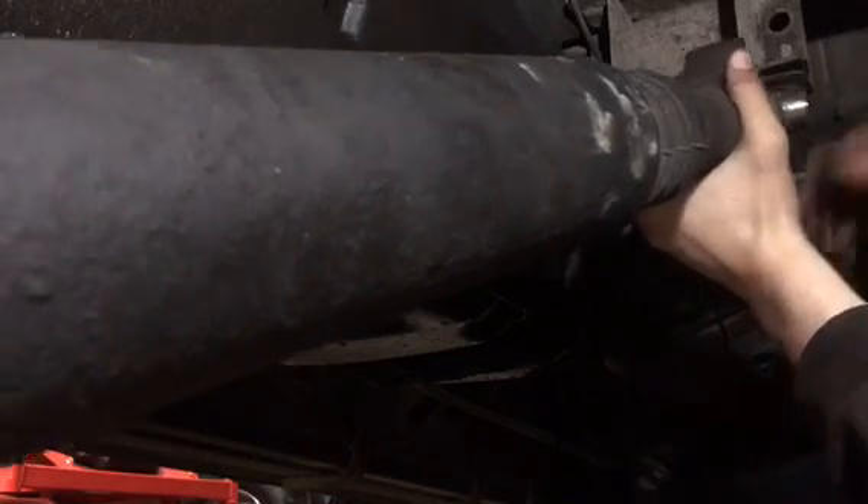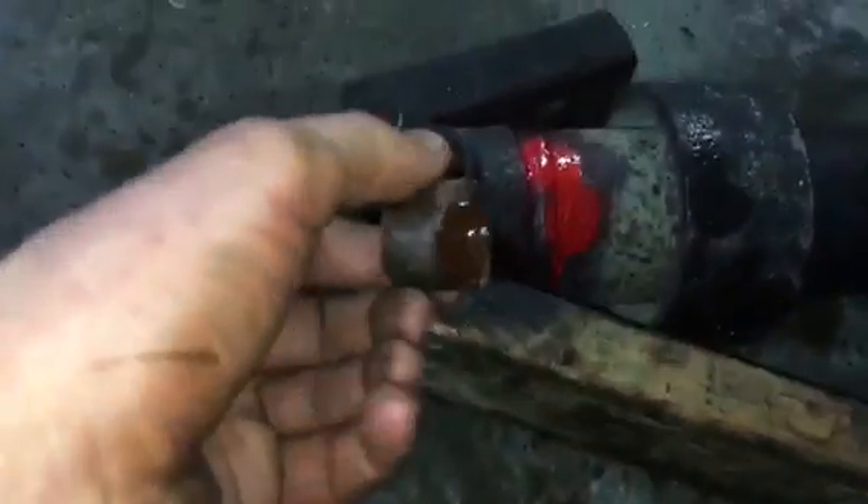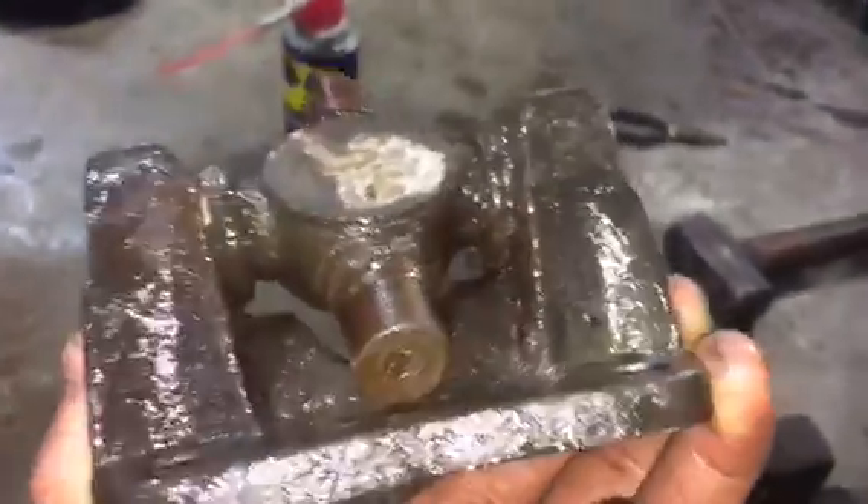You want to put electrical tape around this so the caps can't fall off and the needle bearings won't fall out. Got this part off — halfway out. Knocked these caps out, and this one was broken; this one was actually worn through. You can see how thin that wall is — it's supposed to be round but it's kind of ovaled. That side's still circular, but there weren't any bearings in these caps.